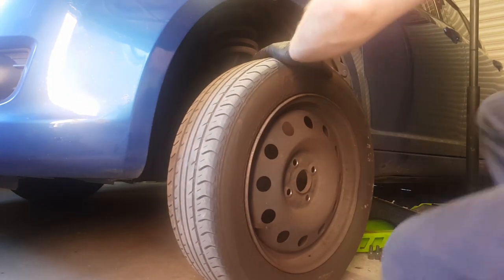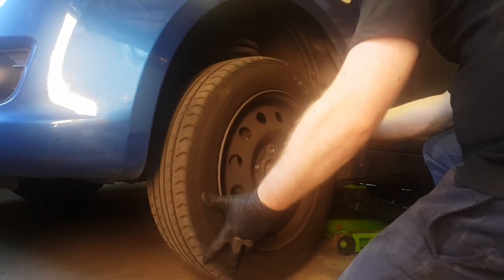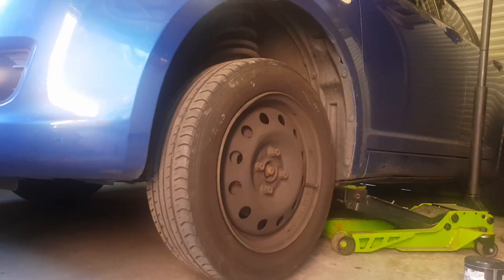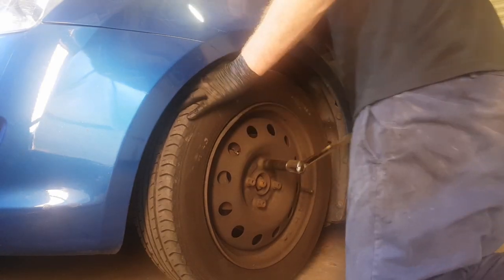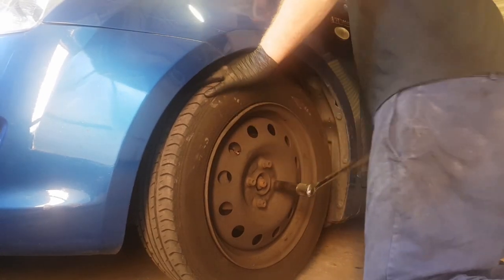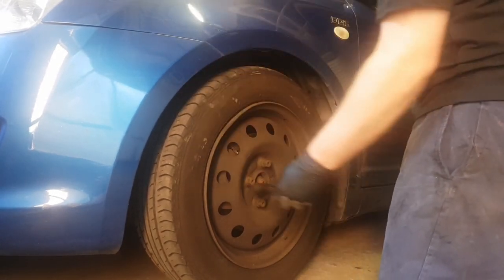Replace the wheel — that's pretty much it. Now obviously this car needs a good road test. Firmly apply the brakes several times; it will make a bit of noise and be loud to start with, but once the pedal goes nice and hard and your brakes come on properly, you're good. Then advise whoever's driving to take it easy for a few miles until the brakes bed in properly. Dead simple.